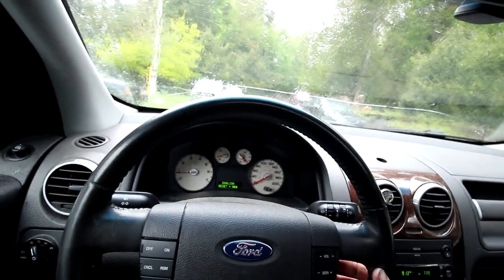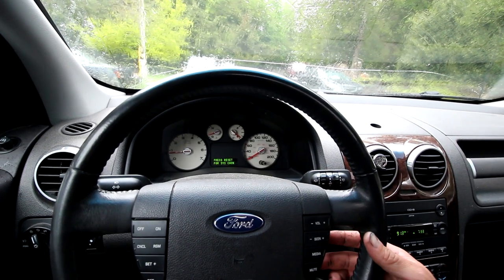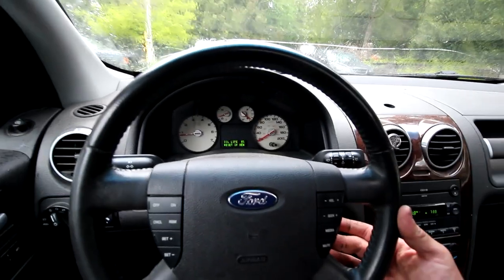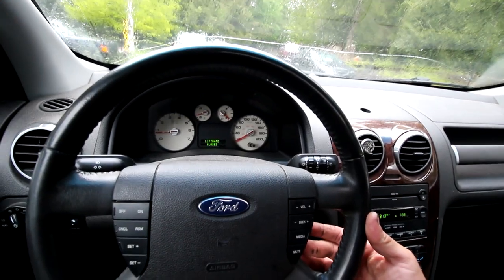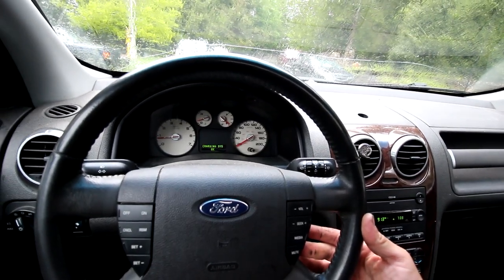Okay, so I'm in the Freestyle. We're just gonna do a reset procedure on the oil. So I just pull up my old internets here and let's see what they have to say. So we gotta hit setup, keep going through, press reset for system check. System check, yep. Okay, so I'll hold reset. If new oil, hold reset. Holding reset. Oh, maybe I was too quick on that one.